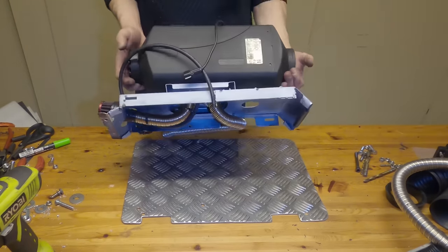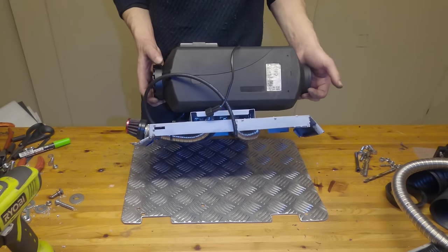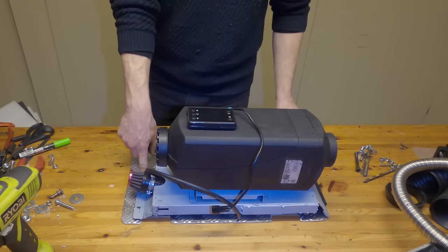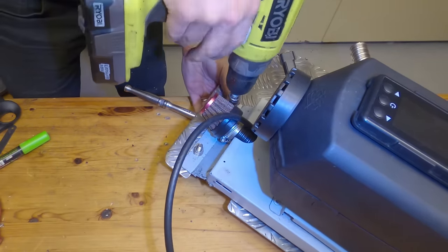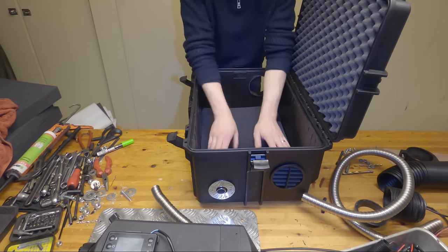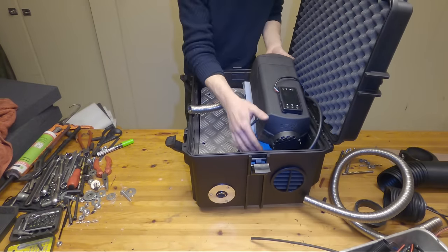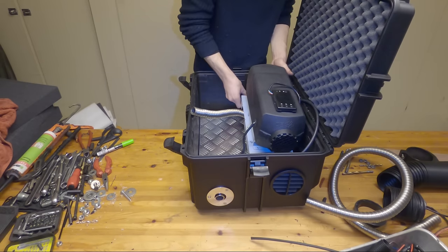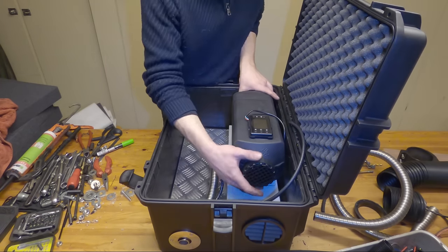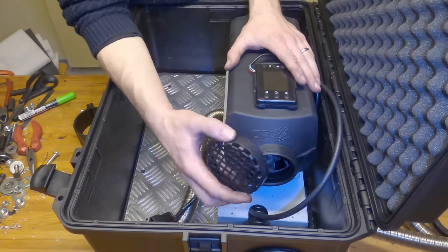I had to do a little bit of tweaking to the frame — it was too high. By bending it and getting it all in place, we've got it to work. The front is on a piece of rubber, the back is not. Let's see if we can get this in. It actually worked. Then we can connect the exhaust. Looking at the unit, it closes a bit differently to the Eberspächer unit — it's got this kind of threaded cap at the back, designed to stop stuff getting in, but we don't really need that.